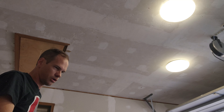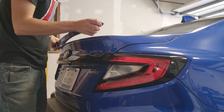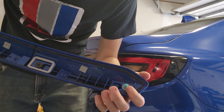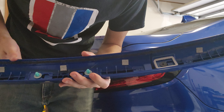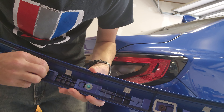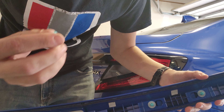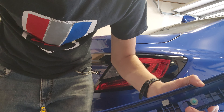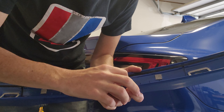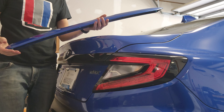You can pull the trunk closed. All you have to do is just fairly aggressively pull the entire spoiler and it pops off. There are actually four total fasteners — two more in the corners I didn't see at first. These are a little different than what I'm used to; you don't pinch them, you just pull pressure against them and they pop right out. Probably just a newer design. I'm used to working on old cars, so it's a learning experience for me. Now we've got the stock spoiler off.